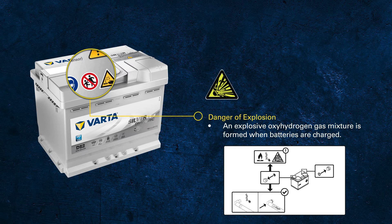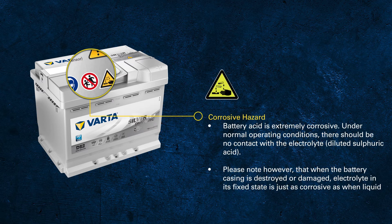Hydrogen is not the only reason to wear protective goggles. From the CCA test we already know that the battery is able to deliver hundreds, also more than thousands of amperes over a pretty long time. Protect your eyes, skin, and clothes from electrolyte. The acid is extremely corrosive.